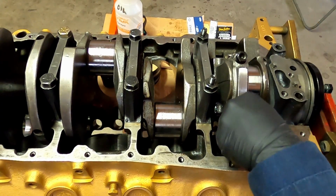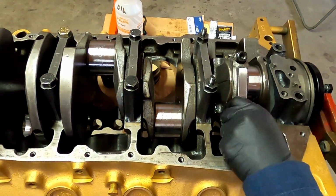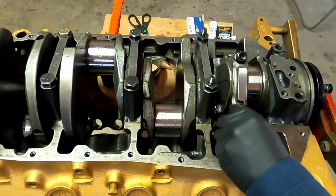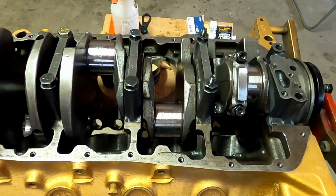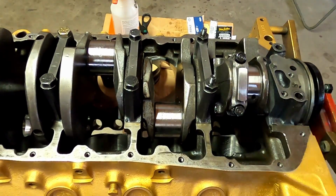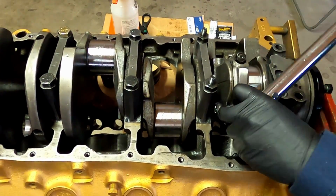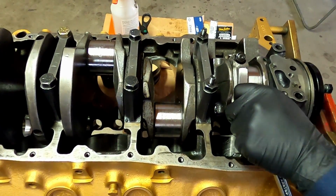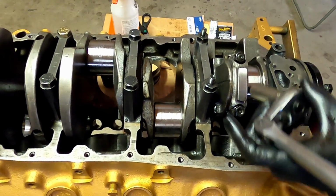That's me using the hand hammer again. It's a tool every mechanic carries around. You want to put oil on the threads. Anytime you have a torque specification, it's always a wet torque spec, with the threads lubricated, unless it says it's a dry spec or specifies something else. Now you torque these into place. And then I'm going to remove the cap.